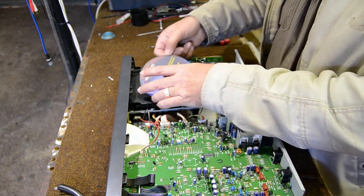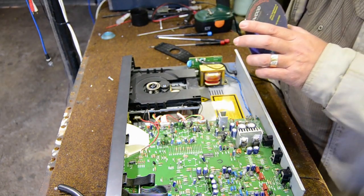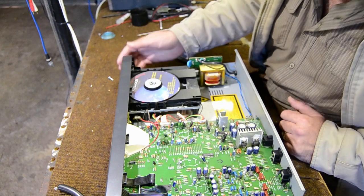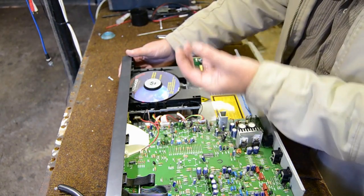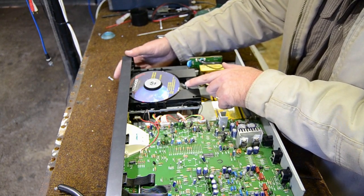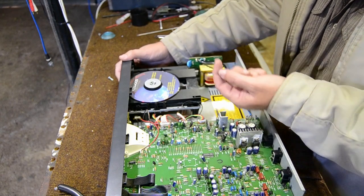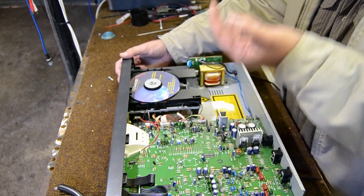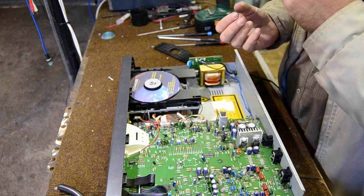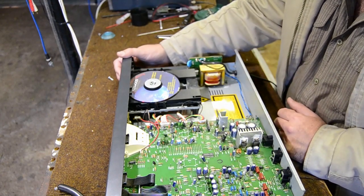This piece has a magnet in it and it's attracted to the metal on the spindle motor. I put the CD on there. Now the laser unit was going up and down — the moment I switch this on it's going to check that everything is in the start position and see if there's a CD. If it sees a CD it's going to try and read it. The first section on the CD is the table of contents, so when it closes it's going to try and read that.